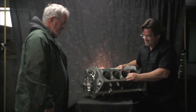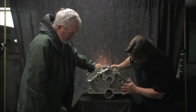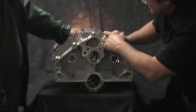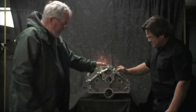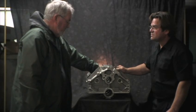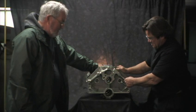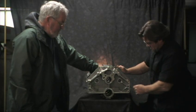We just finished a photo shoot for the new catalog — that's what the big backdrop is all about. On the bell housing, we actually profiled the outside pretty much just to take a little excess off and make it cleaner. On sprint cars we cut away all the material between the bolt holes, but the problem is you get rid of about six ounces of aluminum and replace it with four pounds of mud. It doesn't seem to affect the stiffness — we've been doing it on blocks for years and I've never had one come back broken.